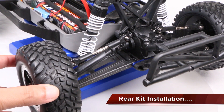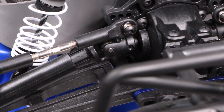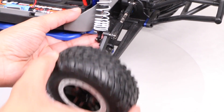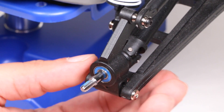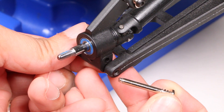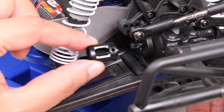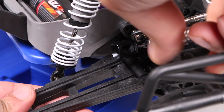It's a similar story with the rear kit too — in fact it's even easier — the main difference being the hub carrier. We'll begin by removing the screw pin from the diff output shaft, keeping this safe as again it will be reused shortly. Next remove the wheel nut, the wheel, plastic hex, drive pin, and washer from the stock axle. Of course we have no steering link here, so we only need to remove the outer hinge pin connecting to the A-arm, and the camber link from the hub, before we can remove the hub with the entire axle assembly. And again we reverse the process by starting with the drive cup on the diff output shaft, secured with the screw pin with thread lock of course.